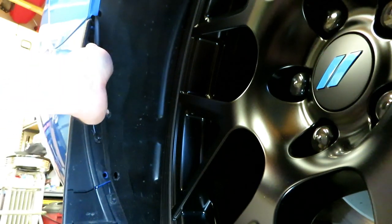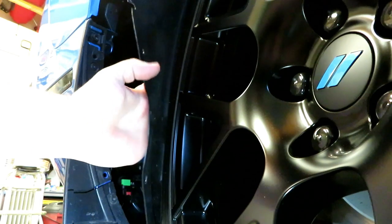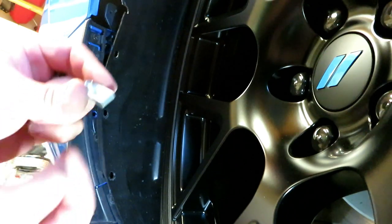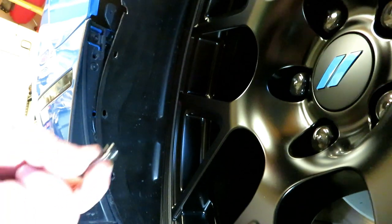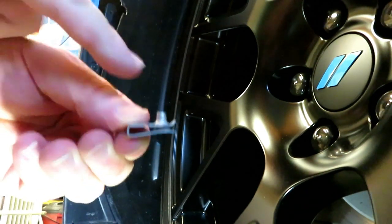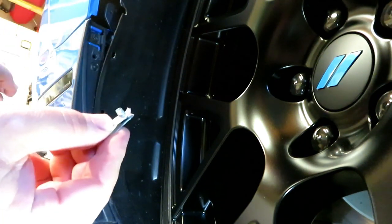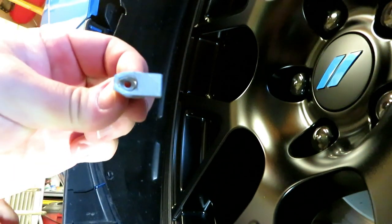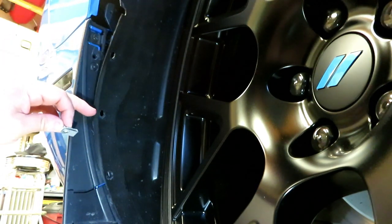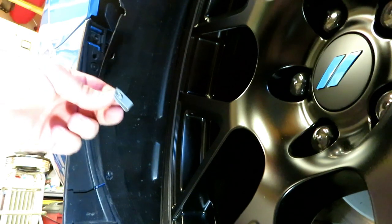Once you get those out, you need to pry the inner fender liner out a little bit to gain access. With the Nova Stretch hardware, you're going to need two of the clips and two of the screws with the snap heads on them. Note that the clip has a nipple on top — that's the threaded part, which goes toward the very front inside of the car. You'll put one clip on the very top hole, the middle hole gets the push pin back, and the bottom hole gets the other clip.